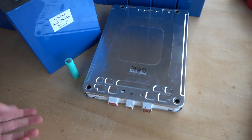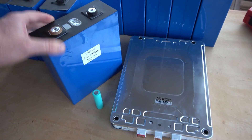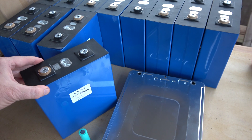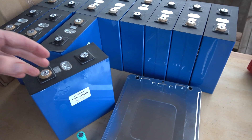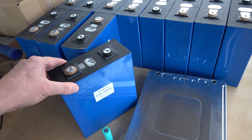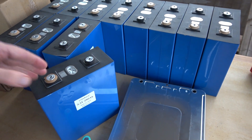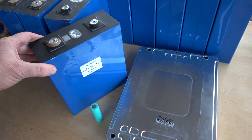I just wanted to go through that and explain — this is sort of going into my thinking in terms of how I'm sizing the battery for the Ford Ranger electric. Outside of NiMH and lead acid — which were actually very power dense despite their heavy weight — there weren't a lot of budget options that I feel had the power density required to run the Ford Ranger electric at its peak capacity. This mindset is also informing me if I do decide to do future EV upgrades or conversions, helping me shape how that battery is going to have to look leading into the design phase.